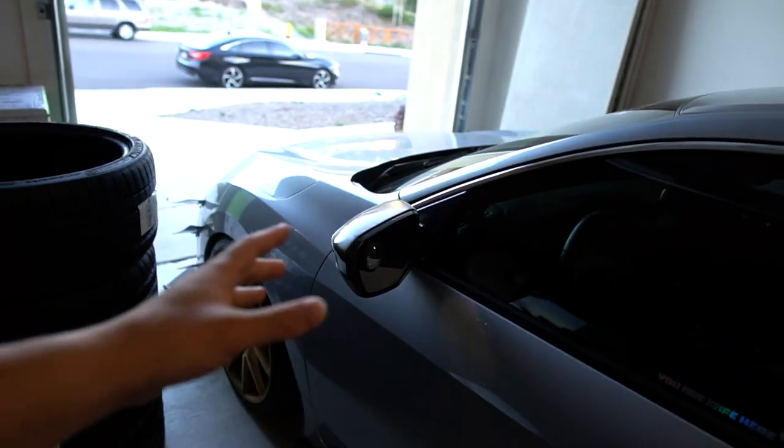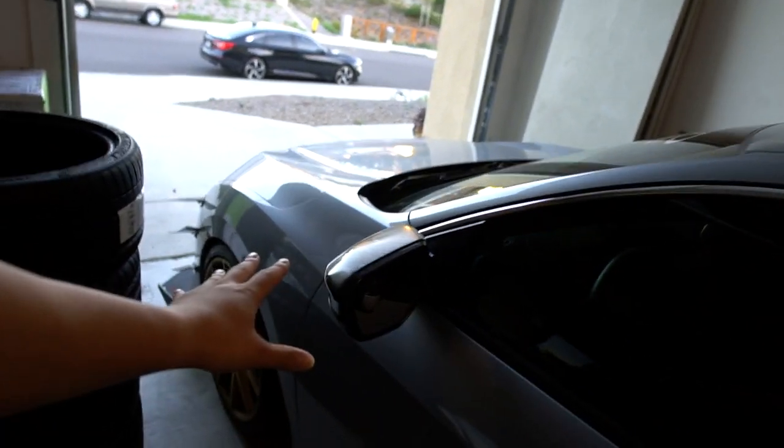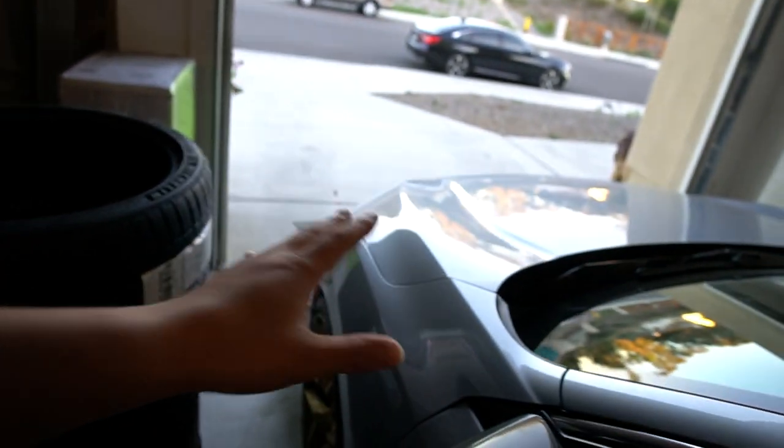The issue that we've kind of diagnosed and basically figured out at this point is it's something electrical. So it's either the MAF housing, or something with the wires, one could be snipped, or they're getting pulled whenever I do a pull, because it only occurs when I do a pull. The car actually just drives completely fine. We're gonna still drive this to Anthony's later today to go wrap the car, and as long as I don't do a pull, the car doesn't trip out. The ECU just starts to trip out only when I do a pull.